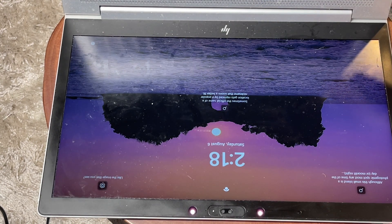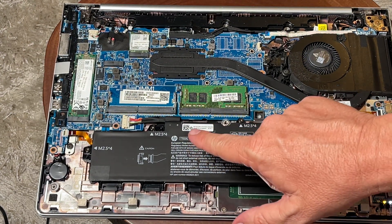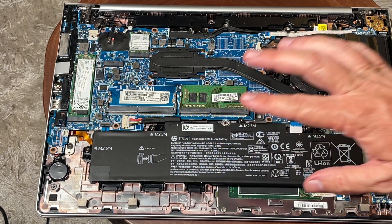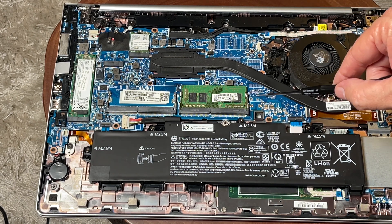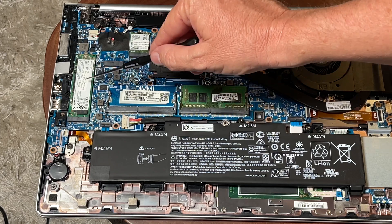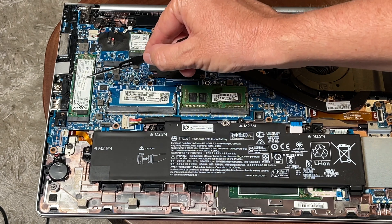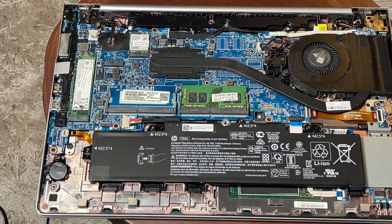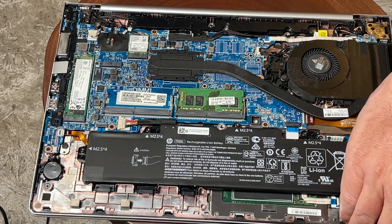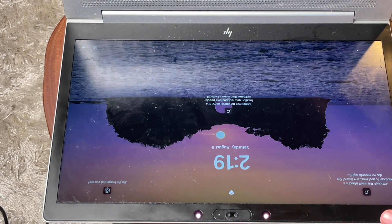I'm going to close the lid and explain further. If you went through these steps and your computer did not boot up, here's one more thing you can try. We reattached the battery and reseated the RAM memory. Over on the far left-hand side is the solid state hard drive — that little screw allows you to remove it. If I hadn't gotten anything, I would have tried removing that and plugging it back in, then pressing the power button again.